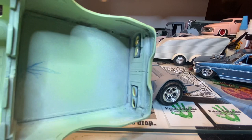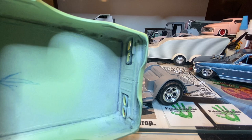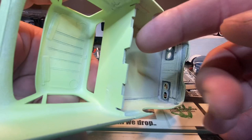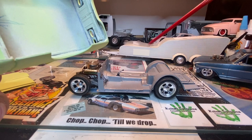That's the underside of the truck. You can see in the back where I cut the center — I had to narrow up the Vette rear end because it was a little bit wider than the Chevy truck, so I cut it and sectioned it in. I laid the Vette tail lights right over top of the Chevy tailgate to make it all work. You can see here where I notched out the back of the cab for the driveshaft tunnel to clear all the stuff on the floor pan of the truck.